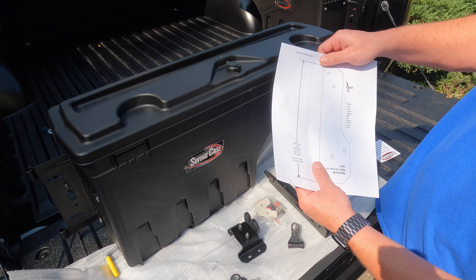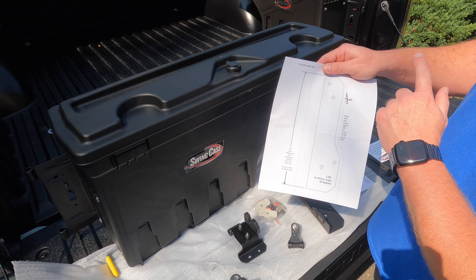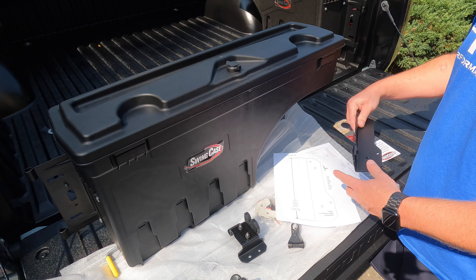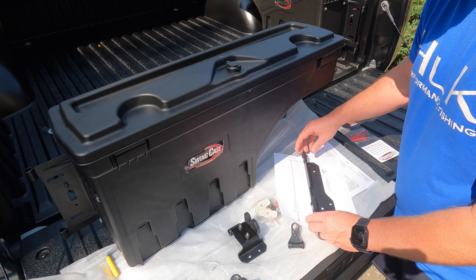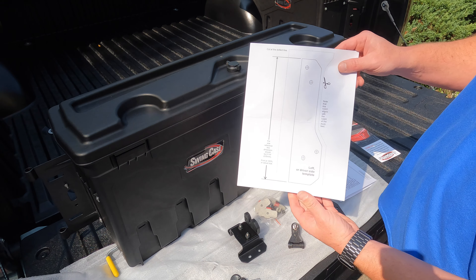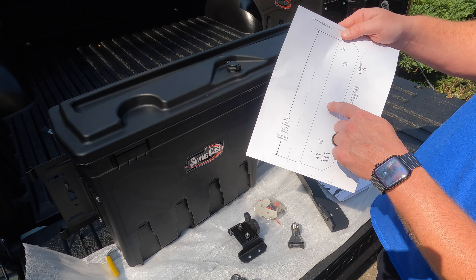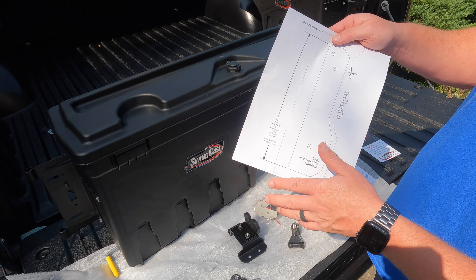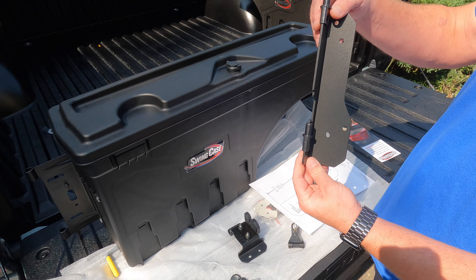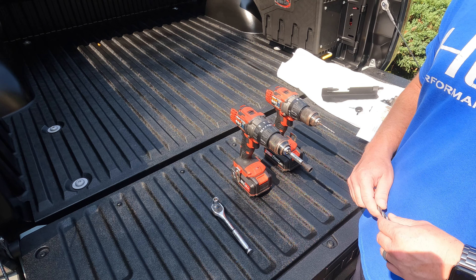One thing I want to mention with your template — this template is for your mounting bracket when you go to put it on the truck. Make sure it's correct size-wise. My passenger side was not; it was actually smaller and the holes did not line up properly with the mounting bracket. Best way to tell is just set the template down, place your mounting bracket over it. This one is very accurate, holes line up perfectly. But my passenger side — the top holes were actually too low on the template. It says this should be nine and one quarter inches; mine was only nine inches, a quarter inch off, and that's how it came from the factory. You don't print this — it comes with your swing case. If not, what I did on the passenger side was I just held it up to the truck and used a sharpie to mark out my holes and then drilled the pilots. Just double check that before you do anything.